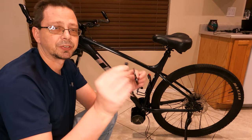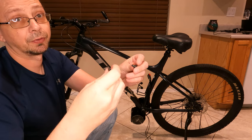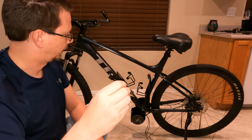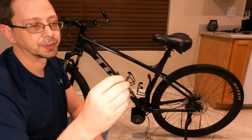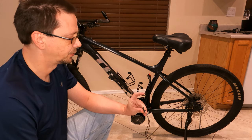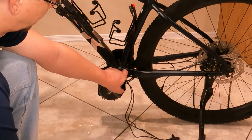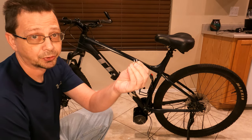Now that I've done the dry fit, I'm going to add a little bit of thread locker and let it dry for a while. A lot of people don't bother, but I'm going to give it a few minutes. That should help prevent vibrations from working things loose. I'm also going to apply thread locker where it clamps near the bottom bracket, and on the bolts for the chain ring as well.